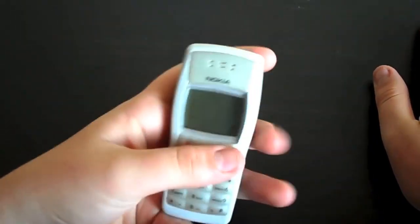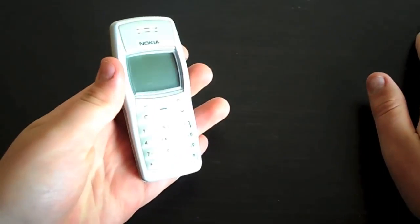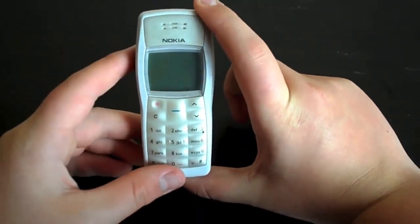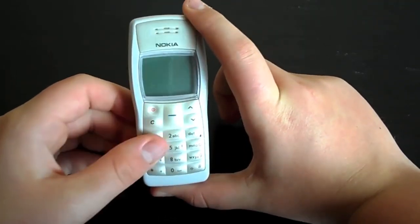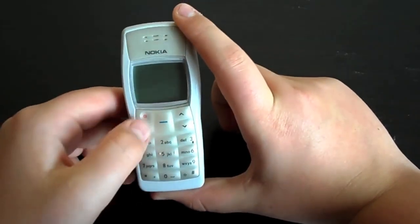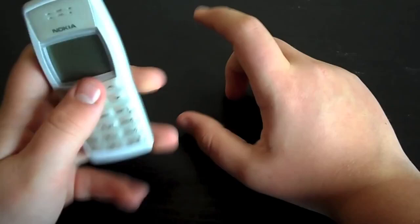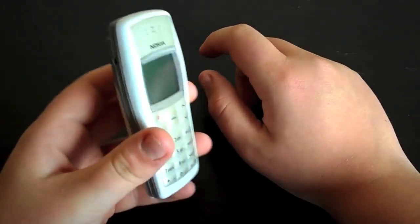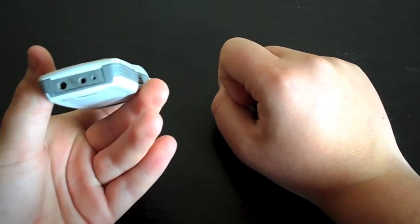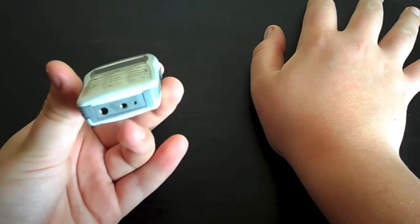In terms of hardware it's a very basic brick phone, slash feature phone style. On the front we have the monochrome screen — it's approximately an inch across. There are buttons 1 through 9, a power button, a C button which is a multi-purpose button, a select button, and an up and down button for navigating menus. We've got a speaker up top and a microphone down below. On the bottom we've got some ports — I think this is a 2.5 millimeter headset jack and a power port.